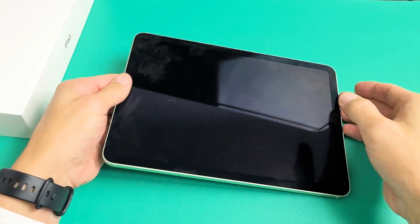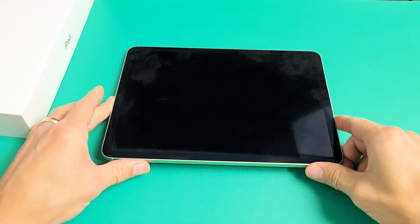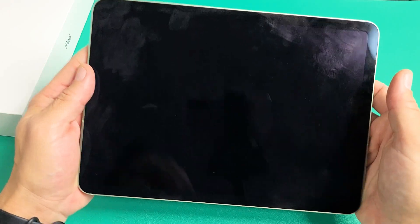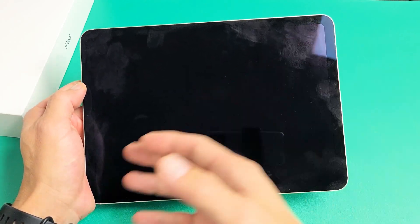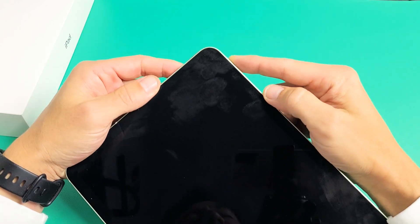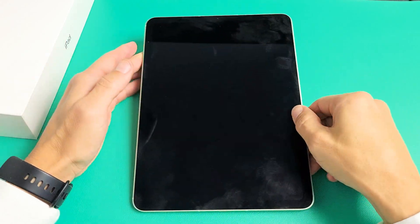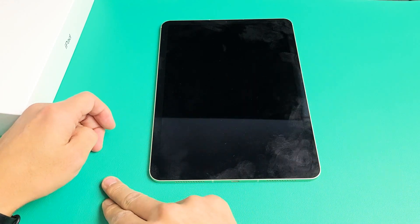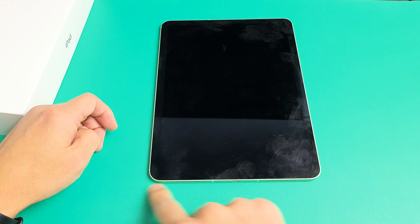The next step: grab your iPad naked — no case on it — and go to your freezer. Put it in there and leave it for 15 minutes. After 15 minutes, come back, grab your cold iPad out of the freezer, and sometimes when you open the freezer and pull it out, you'll see the screen is already on — you're out of the boot loop. If not, with the cold iPad, force restart: volume up, volume down, press and hold the power button and do not let go until you see the Apple logo appear. If you've tried all these steps and you're still stuck, start from step one and try every step again all the way through the freezer. Try it up to at least seven times — sometimes the seventh time is a charm.